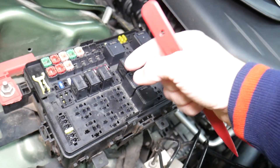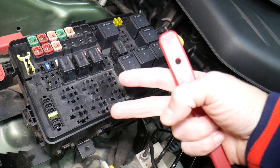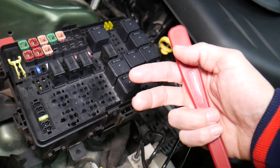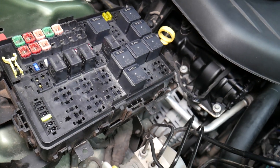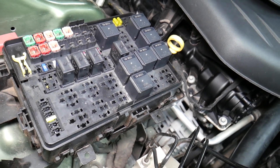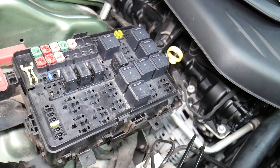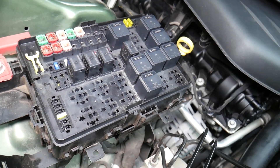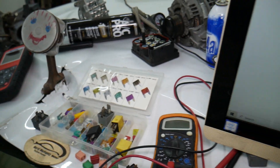When disconnecting the car battery, a common mistake people make is not knowing which battery terminal to disconnect and reconnect first. If you do it the wrong way, you can burn electronics modules. We know about this because we burned the traction control module on a BMW — that cost two thousand dollars. We'll put a link in the description on which battery terminal to disconnect first.